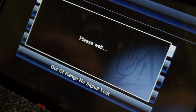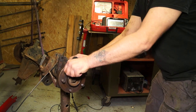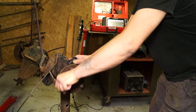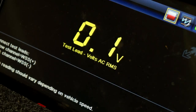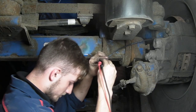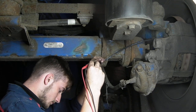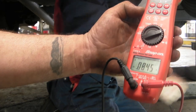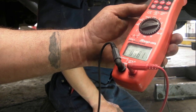With my tester — it's a multimeter and an oscilloscope — one thing you can do is an AC voltage check. You can see I have my socket here to wind the wheel around. The faster it goes, the more voltage you'll actually produce, and it's AC voltage — that's gone up to 0.2 volts. To me, numbers don't mean anything. I need time over voltage so I can see what's going on. Dino here is testing a wheel sensor he's just put in, and with turning this on the multimeter, I really don't understand what these figures are, even though they're set at AC voltage.